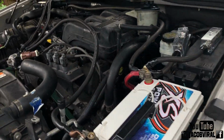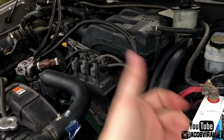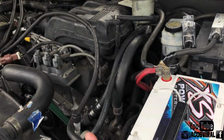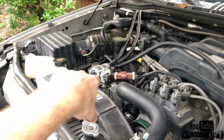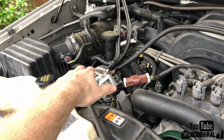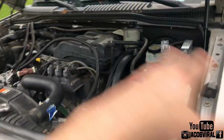And the way I figured that out is what size alternator I have, but I also have to consider efficiency in that. With the vehicle running, if this is my only alternator, then I also need to know, hey, if I'm running my lights, running my AC, running my stereo, everything drawing, go ahead and take 80% of that. So let's just say a 300 amp alternator instead. It's a 350, but 50 amps of that's going to go to my vehicle. So let's just say 3,000 watts worth of alternator, and then I have 900 watts, so 3,900 watts so far.